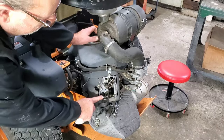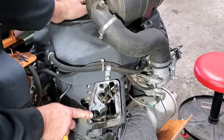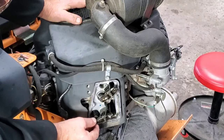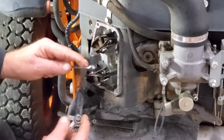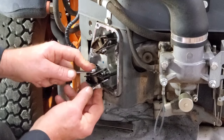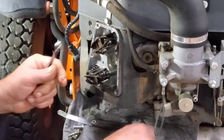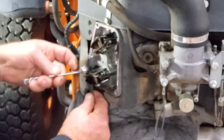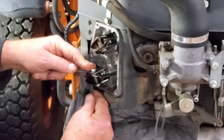Now what I'm going to do — we're going to turn the flywheel up here by hand so that valve is fully open. With that valve fully open, we can adjust this one. Now I know for a fact someone is going to be down in the comments saying you can't do it that way, you've got to do it on the compression stroke. Well, I've been doing them like this for years and it works perfect every time.